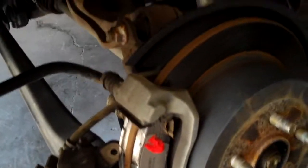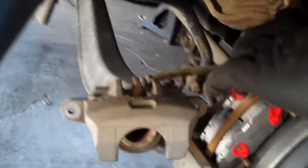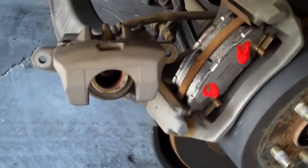When you have it taken apart like this, check and see if these move freely. These need to be able to slide because you're only pushing from one side with the piston, so it's got to be able to center properly. Make sure those are good. If it's not, yank it out and grease it up. You can see this one's got plenty of grease, so I put it back and get it to seat.